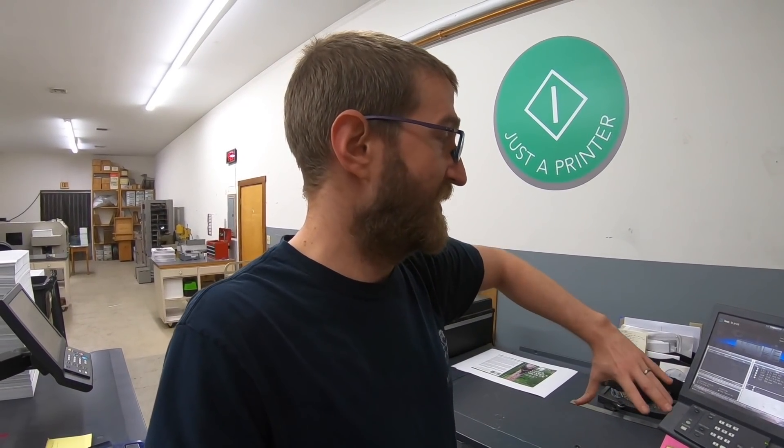So the 1200 this week is being a bit like Bob Marley — always be jamming. The one problem I had is with carbonless 8.5 by 11. I recently started buying some of that and it doesn't like to run with the 11-inch side — it doesn't like to run portrait through there. So I rotated it so the grain direction is perpendicular to the drum. The yellow sheet wanted to wrap around the drum, but all I had to do was rotate it 90 degrees and it ran like a dream.